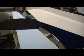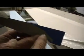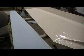These are our flap tracks, and they just slide right along right there. Butch is going to cut these out on his machine out of a phenolic material. This is just kind of a rough prototype to see how it's going to work and to get the movement right of the Fowler flap — see how that goes down. Our flap will be cut separate and it'll be this piece here. It goes out on the top more than it does the bottom, so it'll fit right up in there. And this piece is actually our spoiler in between them. I think it's going to work — that's the plan. Sure looks good on Butch's computer.